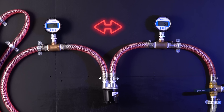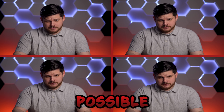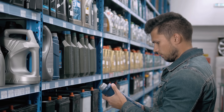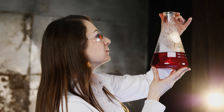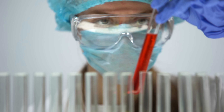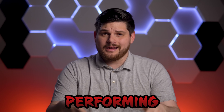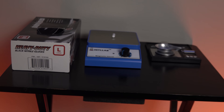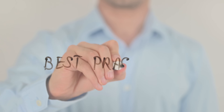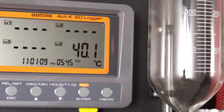For our first test, we want to measure how restrictive each filter is at different flow rates for hot fluid simulation. We want to make sure our testing is as repeatable as possible. Instead of using typical store-bought motor oil like 5W30, we decided to go with AeroShell 41, a MIL-PRF-5606 fluid. This fluid is the one currently being utilized by oil filter testing labs to conduct their ISO 4548 oil filter test. Quick disclaimer though — we're by no means implying we're actually performing an ISO 4548 test here; those tests require million-dollar equipment and a lab that we just don't have. But we want to incorporate best practices to make this testing as fair and repeatable as possible. In order to perform a hot fluid simulation, we heated the oil to 104 degrees Fahrenheit or 40 degrees Celsius.